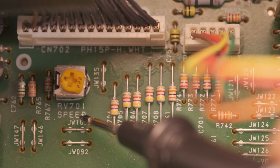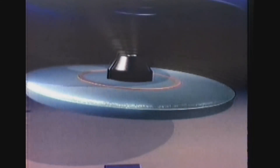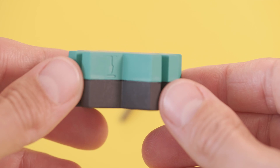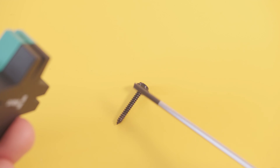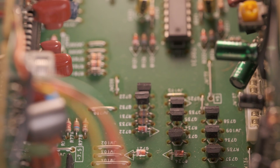You will now realize the type of screwdriver needed for the task. Remember that the mechanism that makes cassettes work is comprised of a magnetic tape that passes around a few magnetic heads, so it's critical not to use a screwdriver with a magnetic tip. If you only own a magnetic screwdriver, getting a demagnetized tool is super cheap — they go for around 3 euros. Now that you have located the adjustment piece and found the right screwdriver, let's dive into our first speed adjustment method.